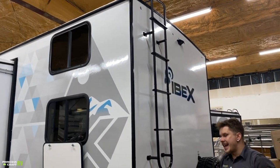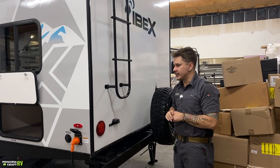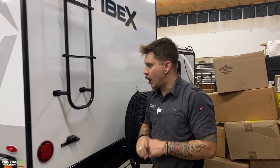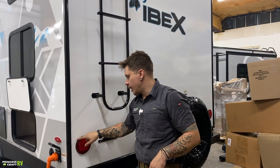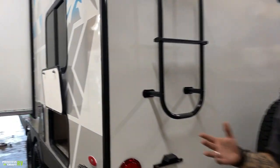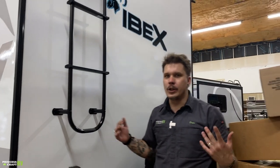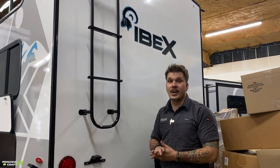Now, on that same 90-day maintenance schedule, it's very important that we do talk about structural maintenance. Anywhere where two pieces come together on the unit, you are going to see some silicone. It is very important that once every 90 days, we inspect every piece where two pieces come together on the unit, and we're going to touch up any degradation in those seals, any peeling, any cracking, any separation. It's very important that we touch that up to avoid any water intrusion.